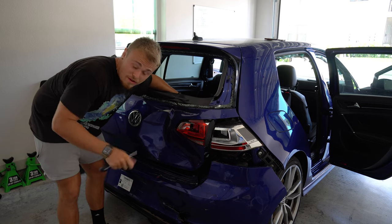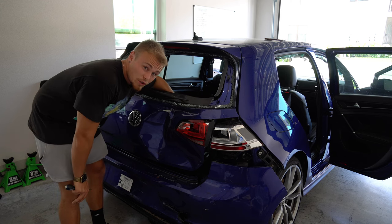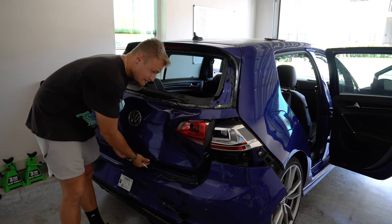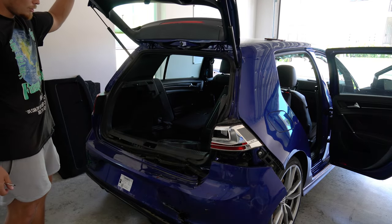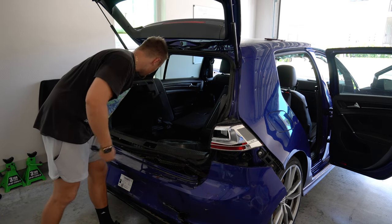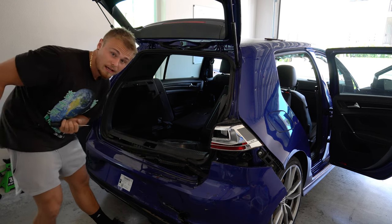There are probably two or three more screws that have to come out, and then the whole headliner should drop off. In order to do that, we have to open up the rear boot — I cleaned it out earlier today in preparation. Inside, a few clips have to come out on the sides, and both of those side panels have to come out, and then the whole headliner should drop out.